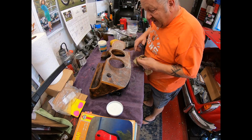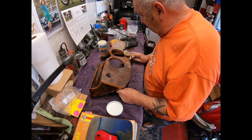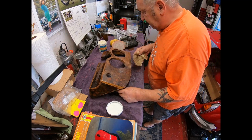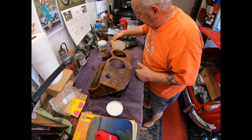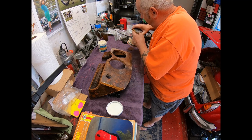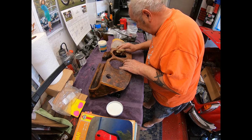Okay, so I've just been over it with 1000 grit. I've got my tack cloth here to get the dust off, and it'll do two things. One, it'll get the dust off. Oh, duh, there's a surprise. And two, it'll show me any areas where I might have missed. How dare you suggest such a thing? Like that area there. Give me a second. Yeah, and I put that on the lowest speed of my orbital sander there, as you saw.